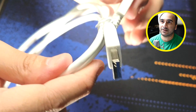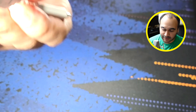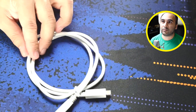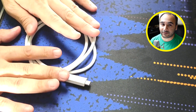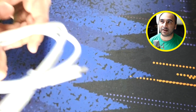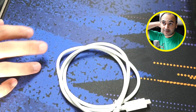This is a USB 3 cable — we can tell it's blue, and it has those extra pins in the back along with the four in the front. This one has a label on it that says SS10, which means it's a 10 gigabit USB cable. So if I plug this into a connection on a port that has 20 gigabit, it will still only give me 10 because of this connector. And if I plug it into a 5 gigabit port, it's only going to be 5 gigabit. I need to plug this into a 10 gigabit port on both ends. There also seems to be a limit on how long the cable can be to achieve certain speeds, unless you have active cables or fiber optics.